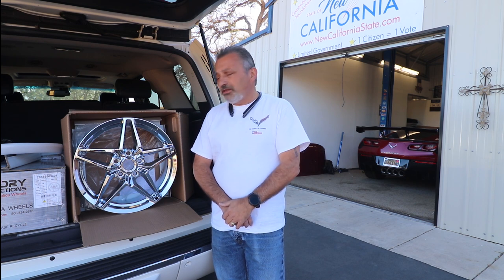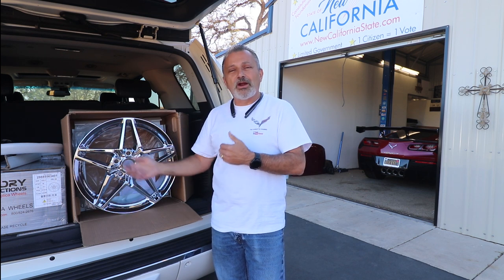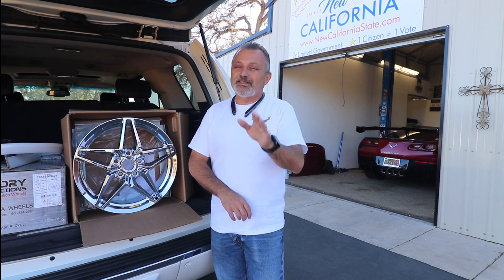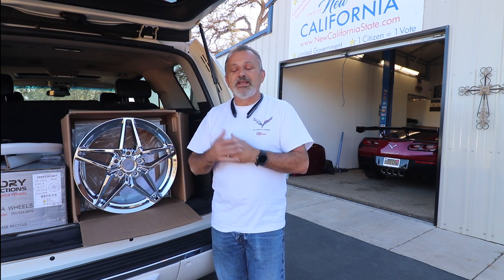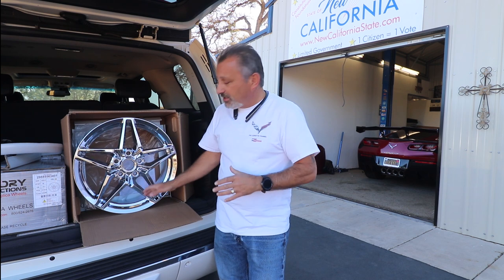Not too long ago, I was doing some more research, constantly calling people, trying to figure out when they're going to get the rims, and nothing. Then I saw somebody on the Corvette forum saying, I think they're going to fit. He didn't say it as nicely as that, but he basically said it'll fit. Terry and Linda have a C5 that actually has an 18-inch wheel, so I grabbed their wheel off the car and put it on my car. Besides the offset being a little bit wrong, so the wheel wouldn't turn because of the offset difference between a C5 and C7, I could tell that I had clearance in the wheel to clear my rotor.